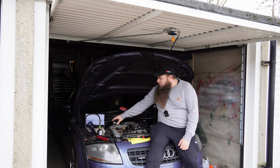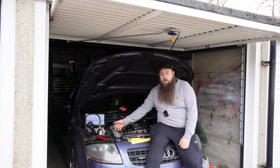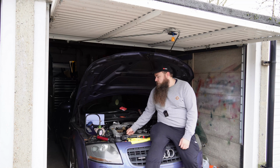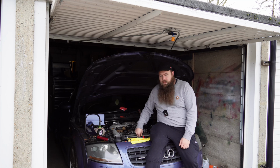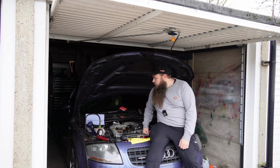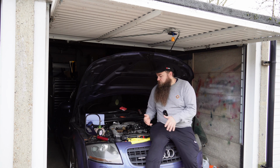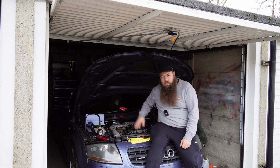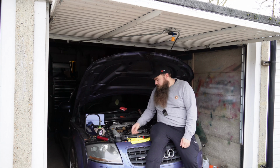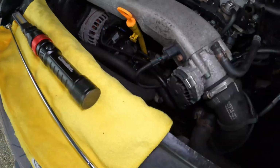We're also going to swap the bottle out just because it's stained. The reason it's stained is because someone hasn't put the right amount of coolant in. They put water in, and obviously water makes it get rusty inside, then you get rusty water which comes out. Coolant will stain, but it won't be orange, it'll be pink. So that bottle's going to get swapped out, and basically when I pull the front end off, which will be the next video or two, we're going to take the front bumper off, take this slam panel off with the headlights out, and then that allows us to get to the whole of the car, because underneath here, I'll quickly show you, is a little bit on the sweaty side.